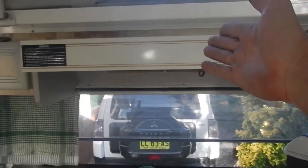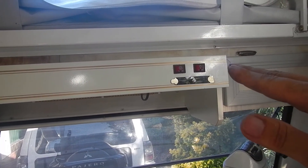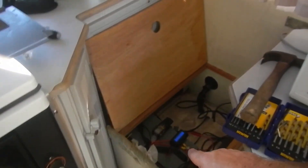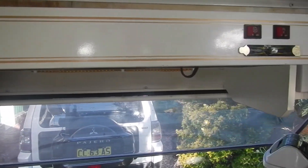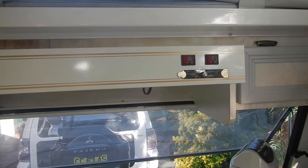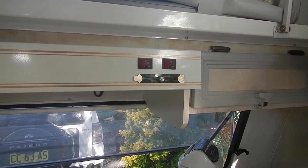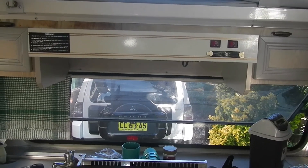So that's it for this one. We now have the fan working on the switch, the controller working, and the LED light under there. Pretty happy with all of that — with the exception of the LED light, I think I can do a better job on that, and we might think about that later on. But we've gone from 240-volt to 12-volt. Pretty straightforward — take your time, be wary. Make sure you've got no power running into anything while you're messing with anything, especially 240-volt. Today I didn't even have the van connected — it was disconnected from any 240-volt. And whilst I was working with battery power, I would unplug this socket here, so no concerns about shorting anything. Coming up: messing with some of the markers and rear lights, converting those over to LED — most of it's going to be a bulb change from something you can buy on eBay. I've been aiming for a video a week, so hopefully I'll have something up next weekend. Thanks, guys — any questions, chuck them up. Like and subscribe. Catch you on the next one.